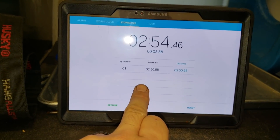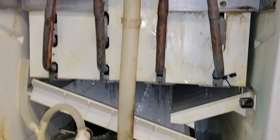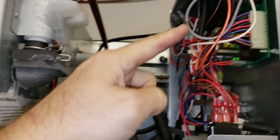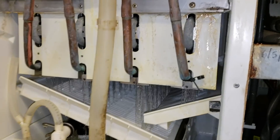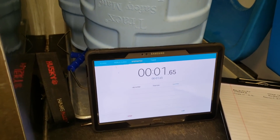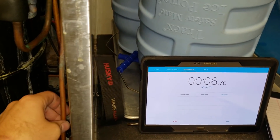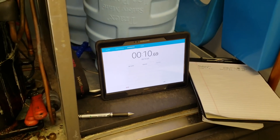It's actually 2:50 because I pushed the wrong button. I turned the machine on and it starts out in a harvest. Until this thermistor senses a certain temperature, a timer happens inside the board — it just turned on right now into the freeze cycle. So when it goes out of hot gas defrost and the water pump turns on, that's the freeze cycle. We're going to hit start on our stopwatch and wait until the five-minute mark, then record the pressures. Hoshizaki publishes the refrigerant pressures about five minutes into the freeze cycle, so that's what we're waiting for.